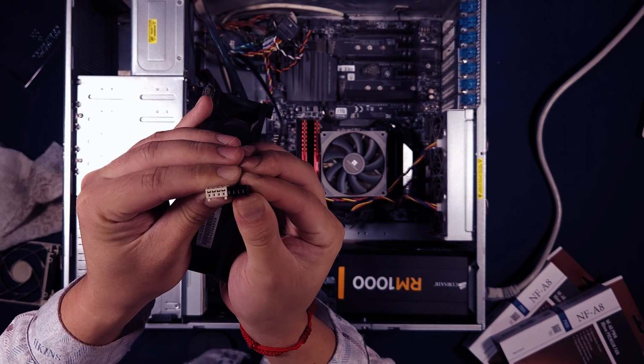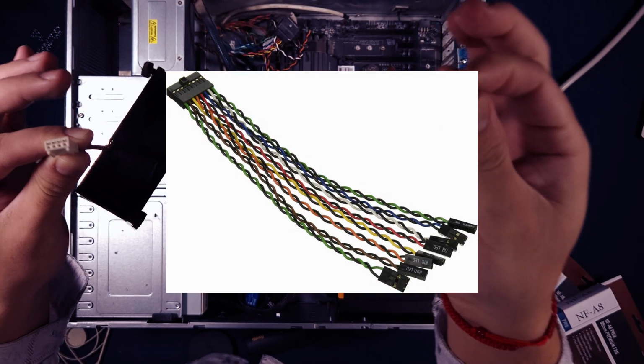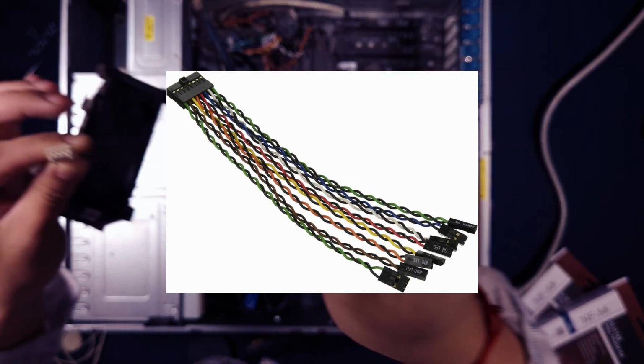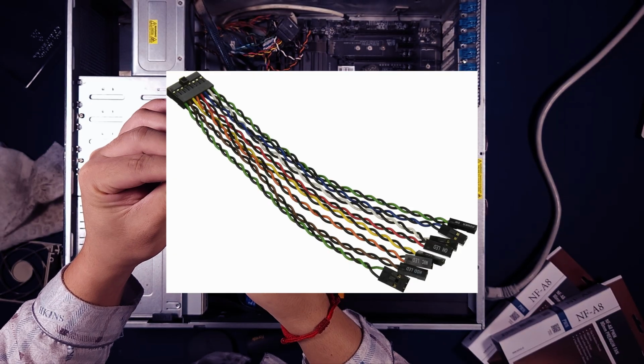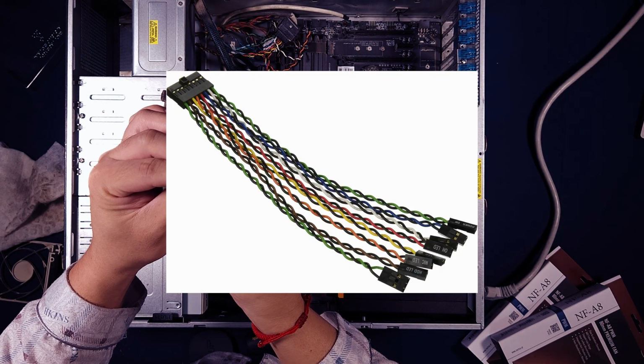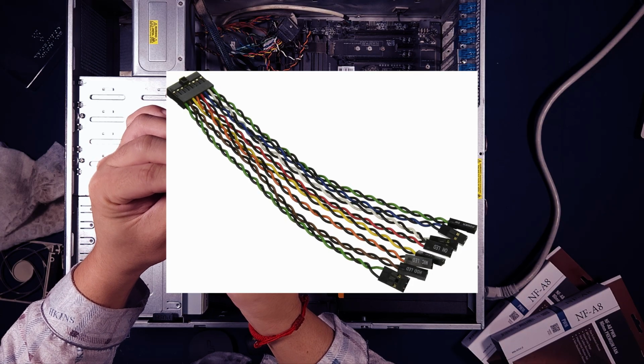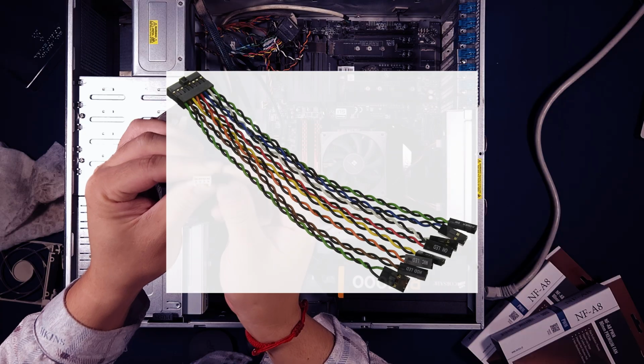The only caveat this case has is that the front I/O panel uses a SuperMicro proprietary cable, so you will have to either buy an adapter to split it off to individual power, LEDs, and reset plugs for the standard ATX motherboard front panel pins. I'll link the adapter I'm using for this case in the description just in case you need one.